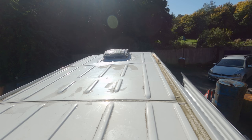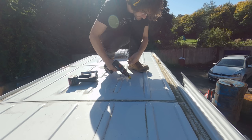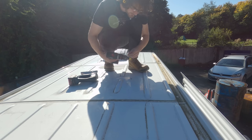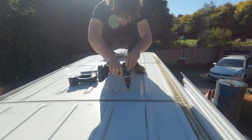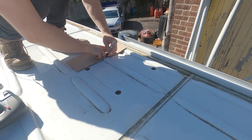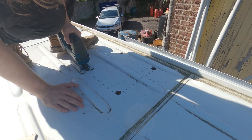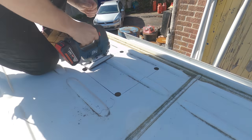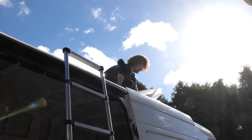As I did with the two previous skylights, I started by drilling out each of the corners with a small drill bit, which would then be used to locate the pilot hole within the hole saw. This hole saw is way better quality than what I used for the previous skylights — I'm pretty far in the conversion and I've used it for all sorts throughout and it's been a godsend. I'll put a link in the description below. I then cut everything out with the jigsaw, filed the edges smooth, and primed them with spray paint to make sure they were nice and protected.